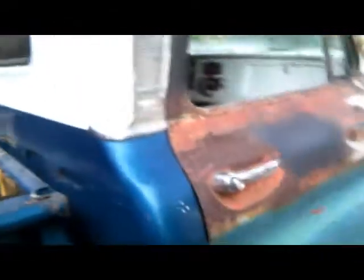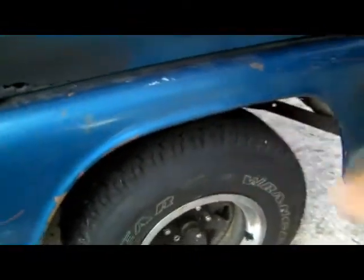I think in the accident this whole door opening kind of shrunk a little bit. And as a result, our door — that's as close as she gets. Actually, that's not horrible, but it's not good either. We've got some issues here too. On the suspension, we're probably going to put new ball joints in, replace the tie rod ends, that kind of stuff. Going to do some work on the rear suspension as well. That's everything I can think of at the moment. There's probably more that I haven't named yet, but this is what we're looking at. Wish me luck.